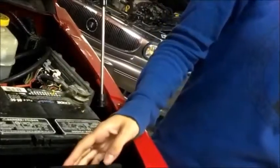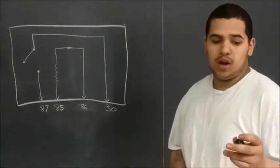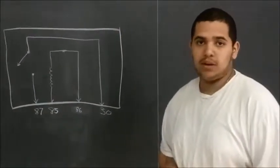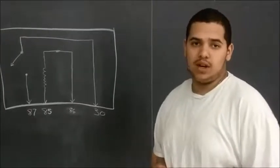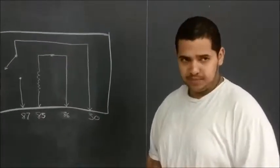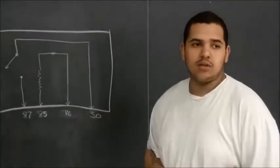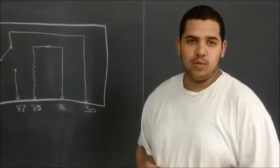This is the fuse box under where the fuel pump relay will be. We're going to pull that out. Today we're going to be talking about relays. You supply power and ground to terminals 85 and 86, which forms a magnet and closes a switch. You connect terminals 30 and 87, which allows the computer to control the current to the fuel pump.